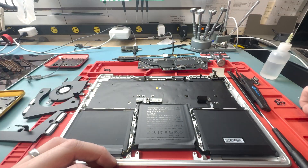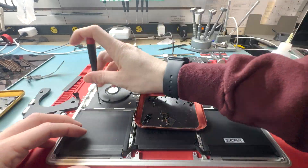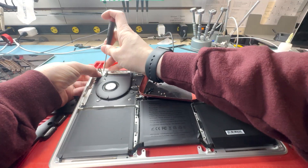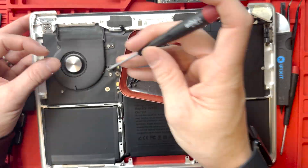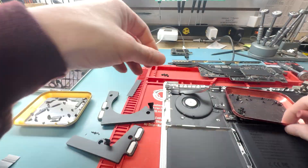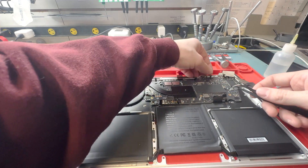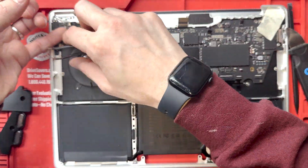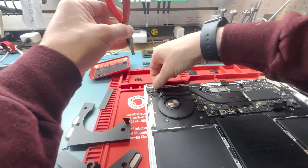Once we've removed all the parts that don't need to be pre-installed, we put in the power button. You'll have to hold it up in a certain position — hold it with one hand and balance it, getting two screws in until you can let your finger go. When putting the logic board back, push all connections out of the way and make sure no connections get stuck underneath the board. You may have to take it out and re-seat it a couple of times to get it to lay down flush. Then put on the standoff screw.